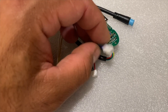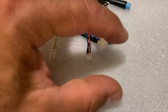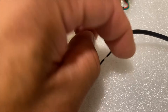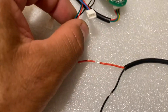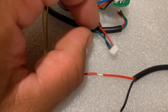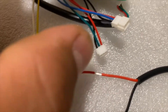So as you can see, this is a female part, a male part, and this one is a female part. Block those two, and then you're going to peel off this wire — the blue wire — and connect from these cables the black cable to the blue, and the red will go to the green wire in the throttle. In the throttle, you're going to have to be really careful not to damage anything because that is needed. So what you're going to do is peel it off a little bit, then connect to the wire, wrap it up, and make sure that it's sealed.